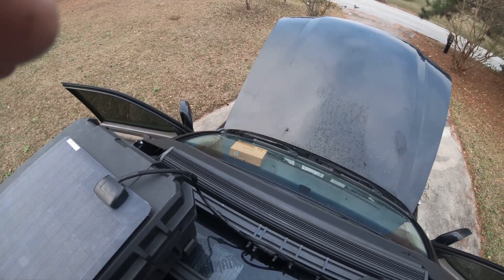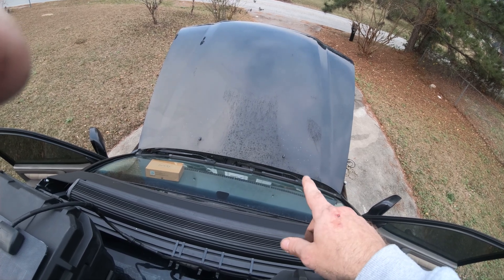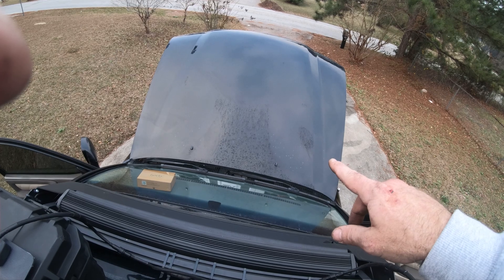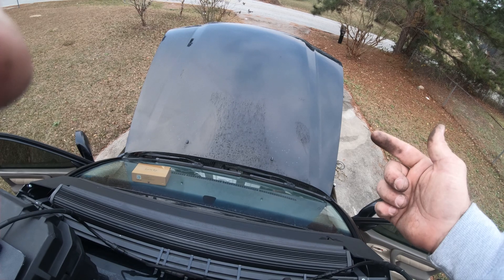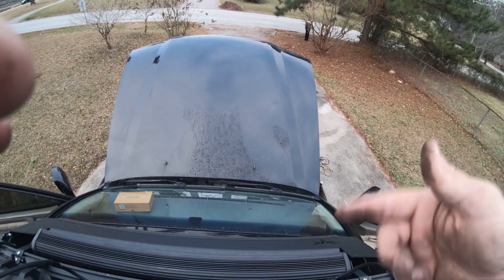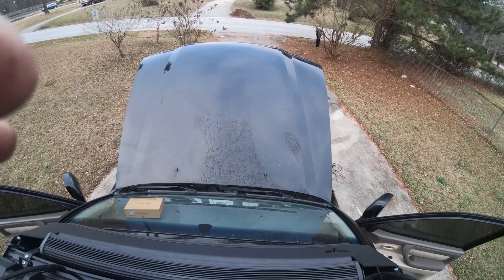These panels are 50 watts each, so I should have 100 watts of solar now. Stage two of my solar install, I'm going to put a 100-watt panel on the hood, run that down to the same bus bar — so the 100 from the hood and the two 50s from up here will all go into that bus bar, routed through the RedArc DC to DC charger. The RedArc will prioritize the solar power input and then augment it with power from the primary battery being charged by the alternator. This video didn't turn out as thorough as originally planned, but I'll link all the materials I used in the description. See you around.